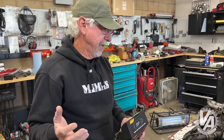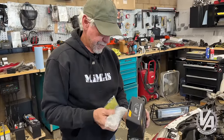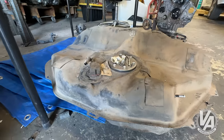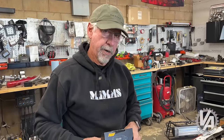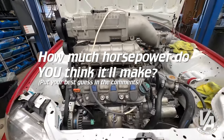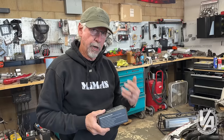We do anticipate needing enough fuel to run this thing, particularly if we can get in the 500 horsepower range. So we went and visited AEM and got one of their cool new high-flow in-tank fuel pumps that has a really nice installation kit with rubber sleeves, new wiring, and all the good stuff. We went ahead and installed that in our tank that I picked up from a salvage yard. That should hopefully give us enough fuel to make mega horsepower. I think it's capable of making 500 horsepower, though initially we're probably going to be in the high 300s, low 400s. These are also safe for E85, and I think E85 is going to be what's necessary when we up the boost on this thing.